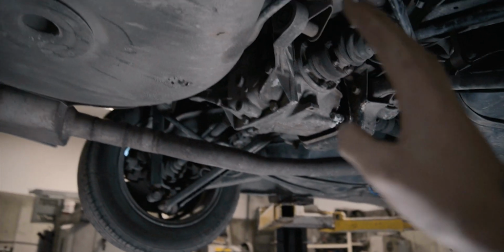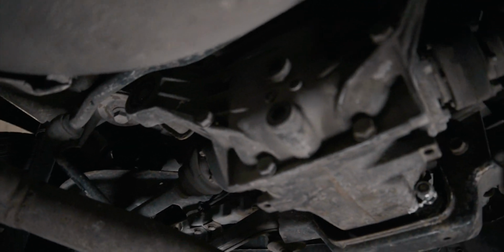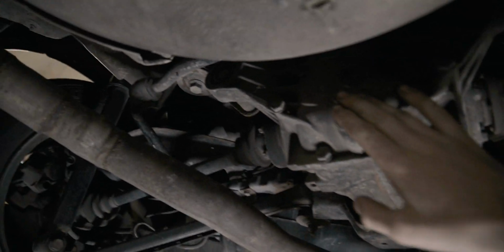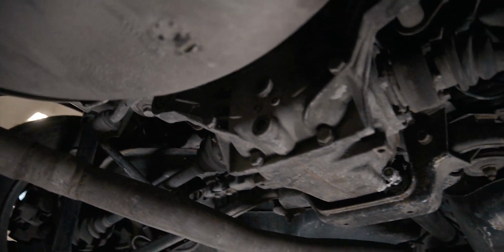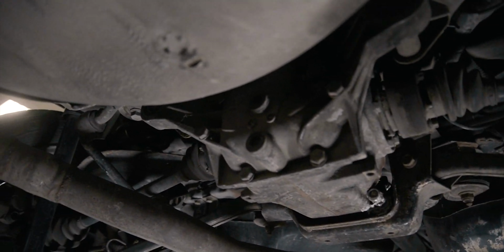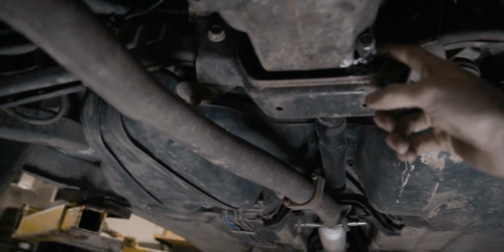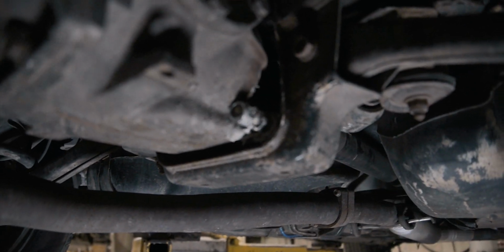Let us first take a look at what's wrong with this. So the rear bushings on this thing look pretty good. This is a 3.15 ratio diff, and I want to change it for a 3.91 so I can get a little bit more torque down low. Mechanical torque, obviously, not engine torque. But the previous owner has a bolt in the front bushing here.